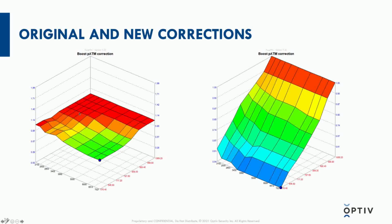And the new one is a calculation that drops the pressure pretty much linearly, and the main reason is because to maintain that pressure ratio while still pushing the turbo as hard as absolutely possible, you need to scale it down in a much more dramatic way. And this has allowed me to safely continue tuning.